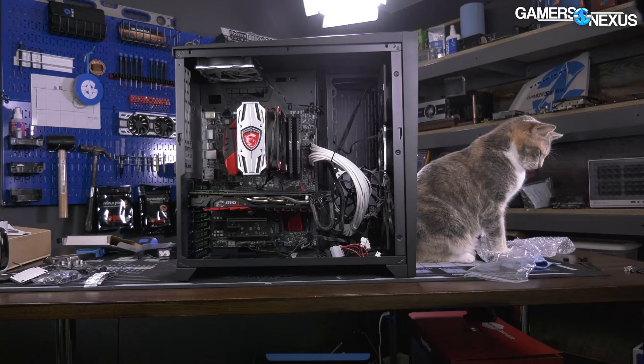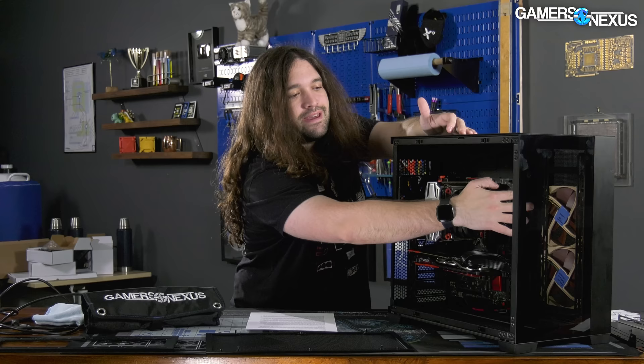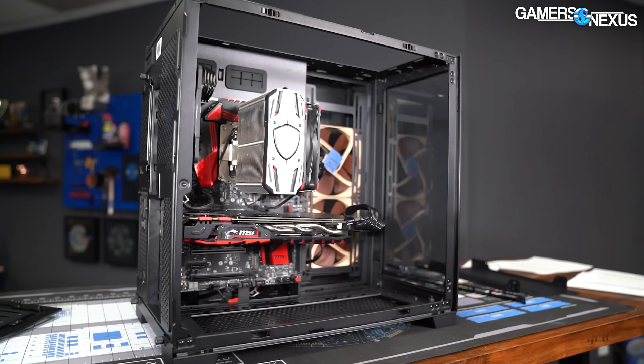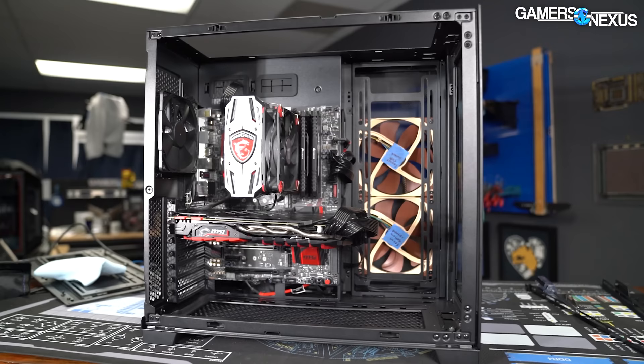As usual, the D version of the O11s is intended for water cooling, but they're completely fine with air cooling — and we found them to be some of the better performers, in fact even better than the O11 Air when it first launched. That was a tragic combination of excessive mesh and dust filters that suffocated the case despite being named 'Air.' The O11D series has done pretty well because despite the glass front and side panels, there's a heavily ventilated side intake with a lot of options to bring air in, plus bottom intake which works fantastically for GPUs.